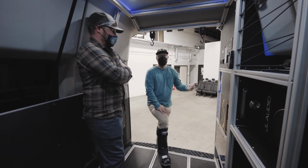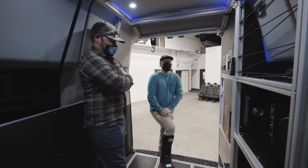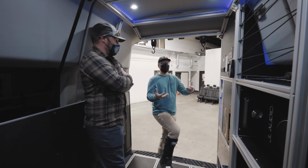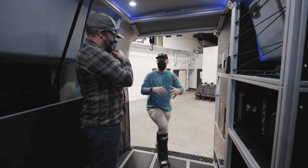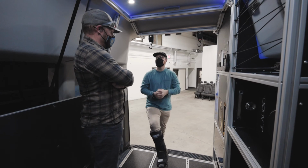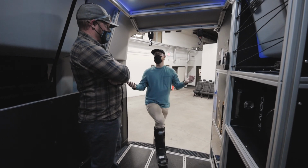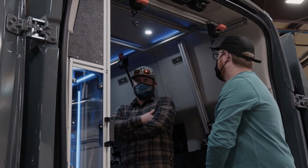And then how to turn on and off the inverter for outlets around the van, which is just this top left button here. Cool. So it can stay on now, today, tomorrow, 6 months from now if needed. There's no harm to that. It's just using a little bit more power than if it was off. Or it is powering a device that is kicking on and off for heating or cooling in here, so that could drain you additionally. So for most people, when you leave your vehicle, look at your inverter and decide if you need to turn it on or off. Should be pretty safe for me just to leave it on if I'm using this every day.